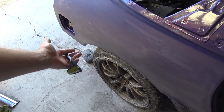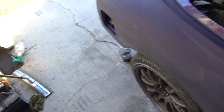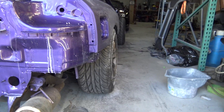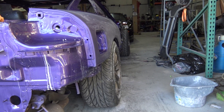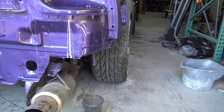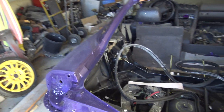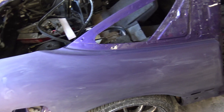Once I'm done with that I'll be able to put the new subframe in with solid bushings, the new diff bushings in the rear, and the steering delete, and fix the whole camber issue. The back wheels are definitely cambered in — they're 18 by 9.5 — and I want to fix that so there's zero camber in the rear to match the front. That'll give me a little more tire contact. You can see where the tire is wearing — it's almost the full tire, but the outside is a little cleaner. The tires don't have very many miles on them, maybe about 50.